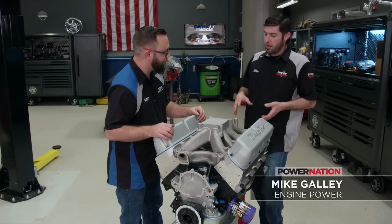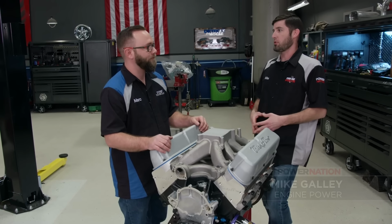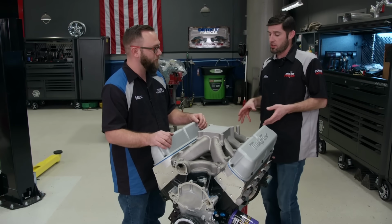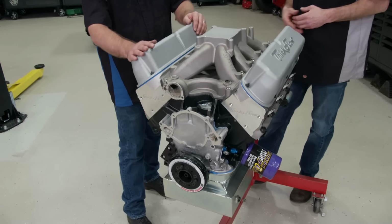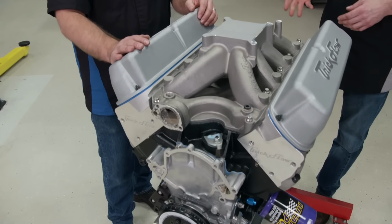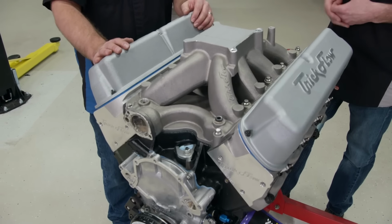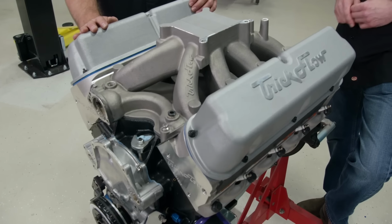You know, Mark, Pat and I wanted to pay tribute to the original 427, but we know they're hard to find parts for, and they're really expensive to make a lot of power out of. So this was a more cost-effective platform to go off of. It's a 351 base Windsor. This block is actually a DSS Race Prep 20 block, all CNC machined with over 31 operations performed to it. It's filled with an Eagle rotating assembly, forged Mahle pistons.